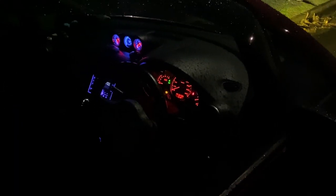It's fixed more so, but I still need to add a bit more fuel into a cold start because it still pops a little. It's a bit like an RX-7 chop. But it is a lot better, because before it would chop a lot more, but now it's actually all good.